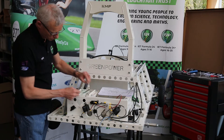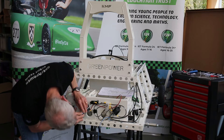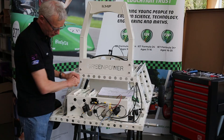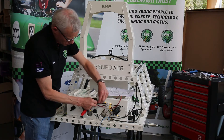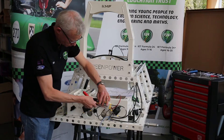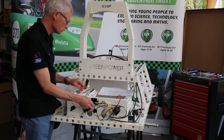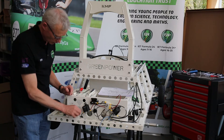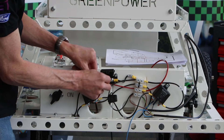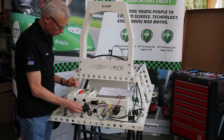Next, we're going to open up our little fuse box - just a little screwdriver latch underneath there. Pops it open, and we're going to undo the nuts in here to fix our cables on. G2E from our top block - little short cable - goes on that side. Now we've finished all our connections on our connector block, we're on to finishing off other connections. G2E, fuse, G2D which comes from the isolator switch, goes to this side of the fuse. We left that tucked in down here previously, so we'll bring that around here and close the fuse box cover.